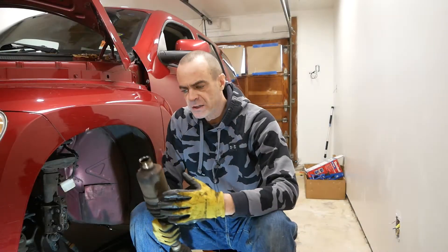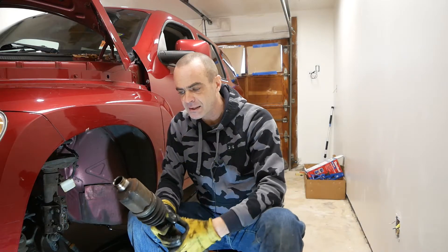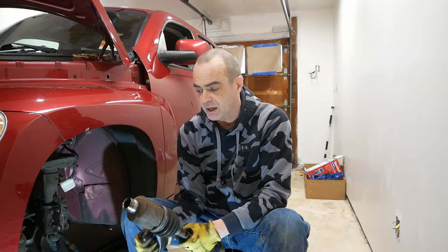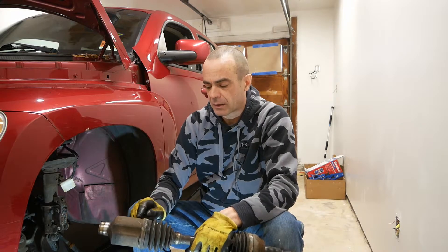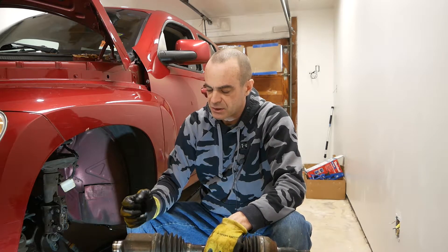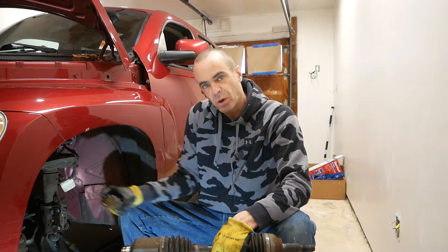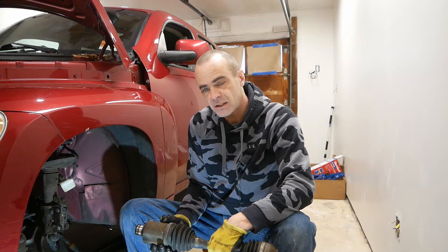So let me show you how I actually got this out. It didn't take a lot of force — just a matter of getting the pry bar in the right spot and a couple little whacks. I did pry a little from the top and then got it from the bottom side. But the bottom line is that if you don't get this whole thing out in one piece — if it separates from the boot — then it becomes a problem, because you need to rig up some kind of tool to attach to the case and pull it out of the transmission. Hopefully your axle is not stuck and it comes out easy, as this one did.